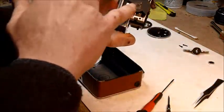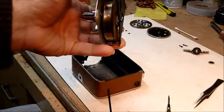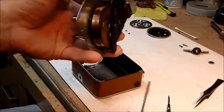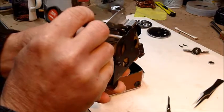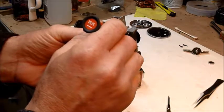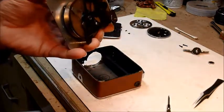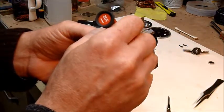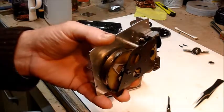Be very careful with this rotary shutter — it's very delicate. Having done all that, you can go into the guts of the camera. There's a gear here that you'll want to grease. I would actually start with oil — you want to get in there and take out any excess lubricant you find. It'll usually be in the form of almost like peanut butter, really, because that's what it kind of turns into after enough years go by.